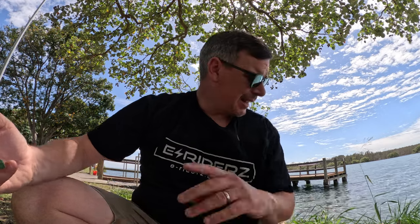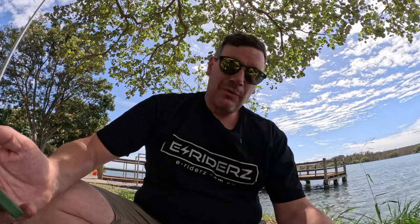They say 40% hill climb. I'd say that's with a much lighter rider than me on it. 60K top speed, I 100% agree that is definitely achievable with this board. 150 kilo weight limit, so 330 pounds on this board, which is a rarity to see a weight limit that high. But again, it comes down to how they've manufactured that deck with the carbon fiber and the glass fiber. The weight of the board, you're looking at 38 pounds, so 17.5 kilos. So not heavy at all for a 12S4P with big wheels on it.